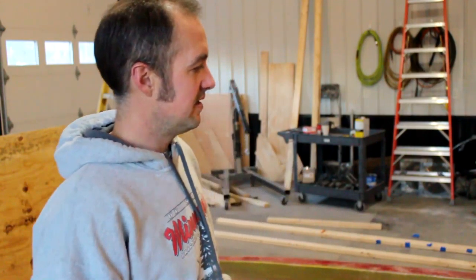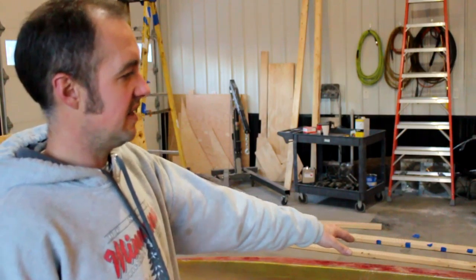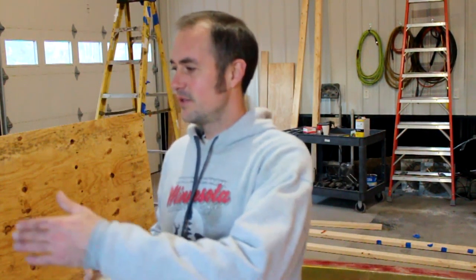That you can't see right now, and screw a 2x4 into the ends of them. You're gonna have to get them level, measure it, cut it, and screw it in. Then we'll take the ones from the middle three pieces that we notched, set them over it, and get the level out, get those level, and start putting bracing in.